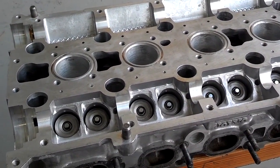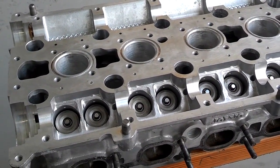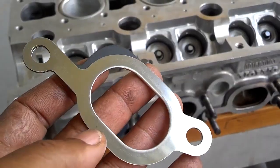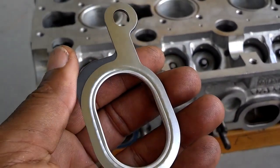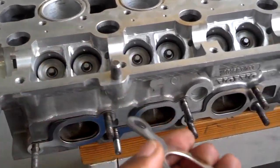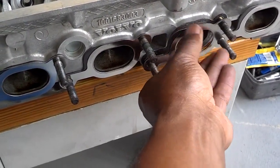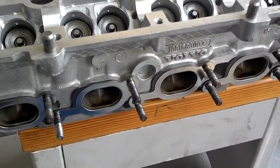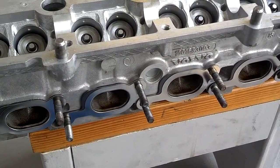You can look at the link in the about comments for the video showing you how to get it clean. The next thing I do is put the exhaust manifold gaskets on. Your exhaust manifold gaskets are like three or four little sheets of aluminum. They go on one way — I believe this ridge goes against the head — so I place all five of those in place over the studs, and now I'm going to tie them in place with some dental floss to keep them from falling off when you lower the head in.